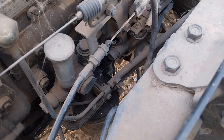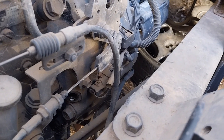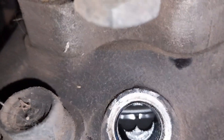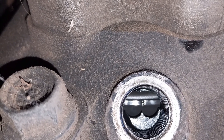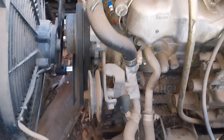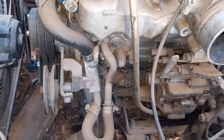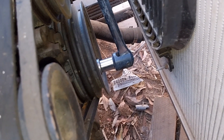There is a gasket on this one as well. Let's have a look how this is aligned — there should be a pointer on the left hand side. Let's get some light on there. Yes, there is a line — that is good. So the injection timing is spot on, and that is really good, as it corresponds with the alignment here on the timing marks.